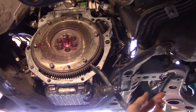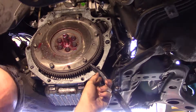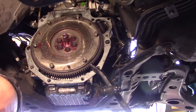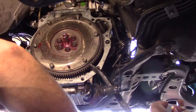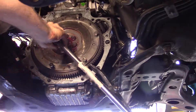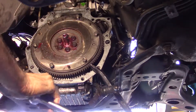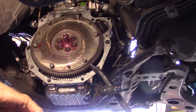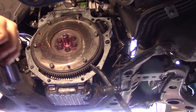If you can see here, what I did was I took a crowbar, put it in one of the teeth, and then wedged it up against the ground so that way I could get this on and basically break them all loose. Now they're all basically hand tight, so I'm gonna take those off and then hopefully we'll be able to pop this puppy off and be good to go.